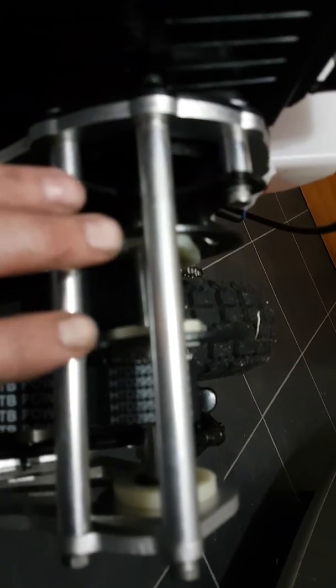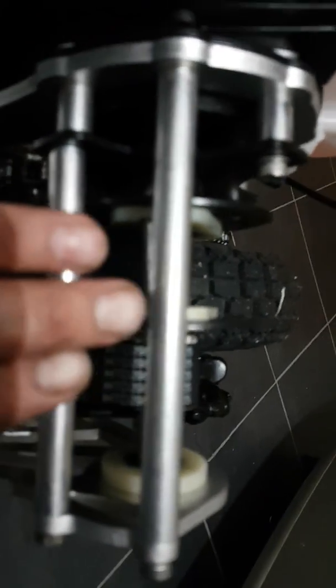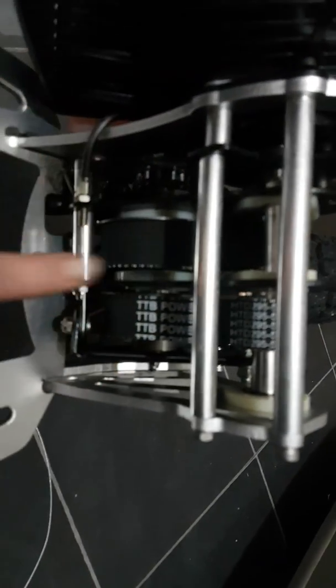As for getting to it, there's a plastic cowling which goes over here. You'll be able to take the back piece loose. There are two bolts at the top and two underneath the engine. But to get the front cover off here, you will have to take this bar off. You just take the long screw and pull it out. I also took this out because there's a little bit of play, which gives you enough movement after this bar's gone to pull the plastic cover out of your way, to give you plenty of room to work.